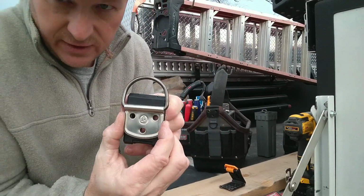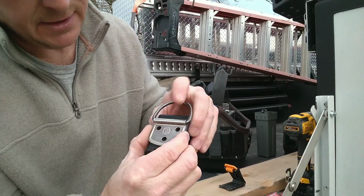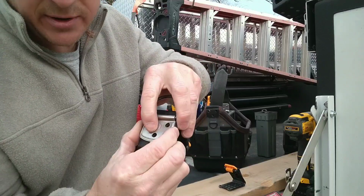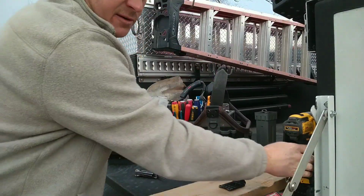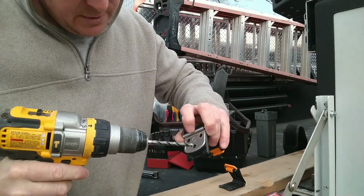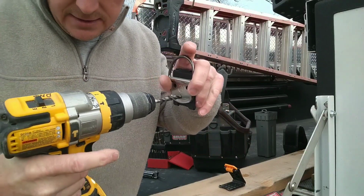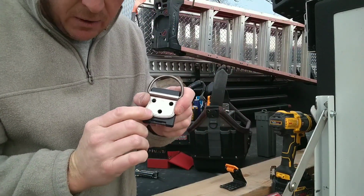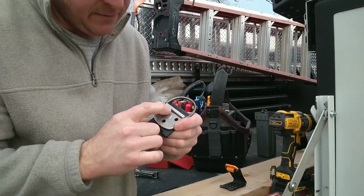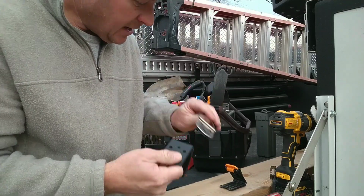Lay this Veto clip that comes from your Tech Ot-Mc bag onto it. Drill your bottom hole first. A 9/32 drill bit is what you're going to use, chucked in your drill. You're going to drill through those like so, and then you can take a 1/4 inch bolt and place it in there as a pin to line up the rest of these 2 holes. After you get these lined up, drill these other 2 out, and I've already done that.